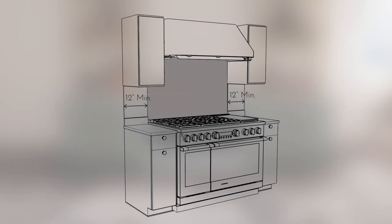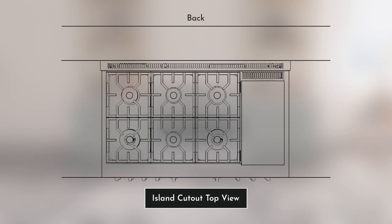The minimum clearance of the unit with the adjacent wall requires 12 inches on each side. The minimum clearance of working areas adjacent to the range top requires 18 inches between the bottom of the wall cabinet and the countertop. The width and length of the wall cabinet requires 12 and 16 inches respectively. The distance between the two floor cabinets requires 48, 36, or 30 inches depending on model. For island installation, a minimum of 2 and 1/2 inches from the cutout to back edge, and a minimum of 3 inches from the cutout to side edges of the countertop must be maintained.